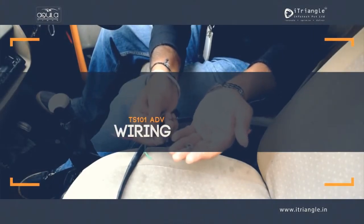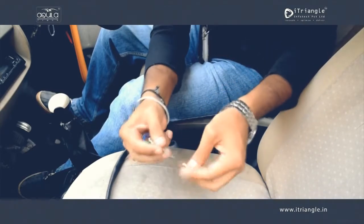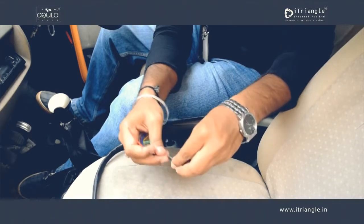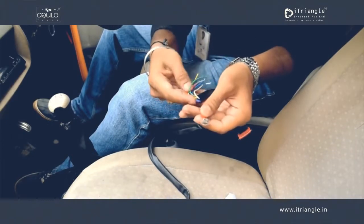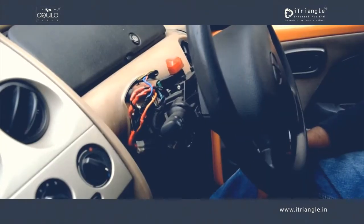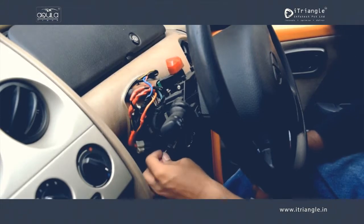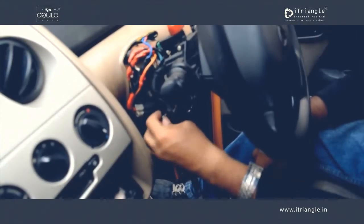Going ahead with the installation, identify the red, black, and the green wires at the open end of the field wiring harness. Now, connect the electrical lug to the black wire for proper connection. It is preferred that the electrical lug be crimped and insulated properly with the black wire. Now, the electrical lug has to be connected to the chassis ground. It can either be found near the ignition switch or else anywhere on the body of the vehicle.